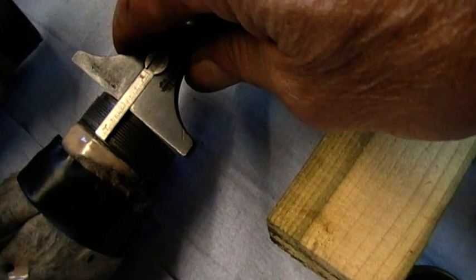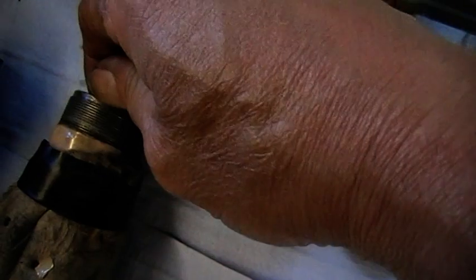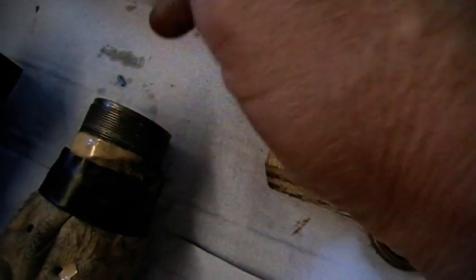Quite often you'll see these bikes and they'll have a couple of threads underneath where this screws down, so that goes onto there, and you'll see there'll be a couple of threads like that left over. So that's where they've been assembled correctly. I thought, oh well, it doesn't go down, it must be jammed. No, it's not. It's spaced correctly. You actually want the centre of that O-ring smack on this little bit of plain land here, and hopefully that should seal.